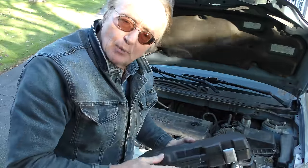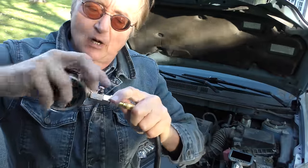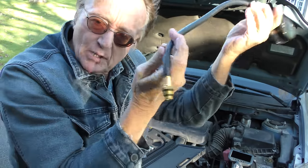But if not, and you've got an oil burner on your hands, the next thing to do is a compression test of the engine. You get an engine pressure tester — they don't cost much — that screws into the spark plug hole, and you do a compression test. If your engine is really worn out and the compression is really low, you know those cylinders have a problem. If they're all low, it's all worn out; if three of four are high and one is low, you know that one has a problem.